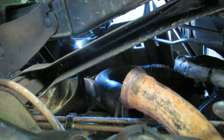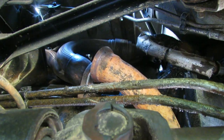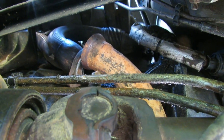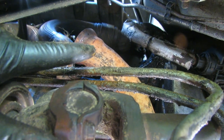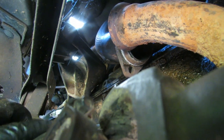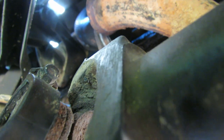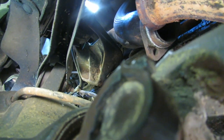With the pipe moved, you can fish things around there. What I did was pull down on the pipe and rotate it out, then I could slide the two metal lines between the header and the actual exhaust pipe. Now that I've got the lines out, installation is going to go the same in reverse — I just pulled them out through this large cavity right here and I've got to fish them back up through there to get them where I need them.